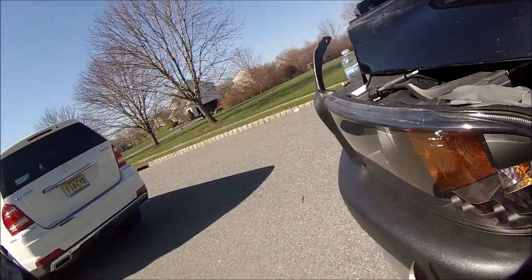Everyone with a stock bumper basically has this problem where the plastic always likes to do whatever it wants to. Sorry, the camera's being really stupid — something happened, the files corrupted for the video. So now the low beams work on both sides. The fog lights also work. But when I switch to the high beams, the passenger side doesn't work, which is annoying. Maybe I shorted it out or something. Either way, I was going to replace them eventually, and now it's easy to go back and put those bulbs in because it will take two seconds.